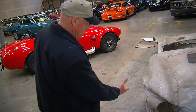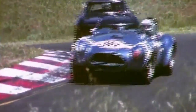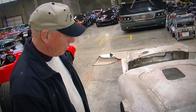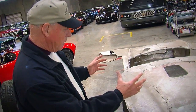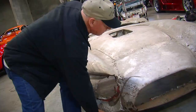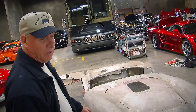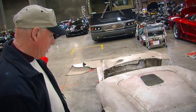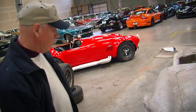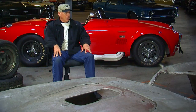The only thing that's missing in terms of the front — of course, you had the headlights, which had to be functional. You taped them up during the race so that if they cracked or broke, they wouldn't shatter all over the place. It was originally kind of a street car, but now you realize just exactly what it is: a straight, functional car. It had the brake ducts hooked up down here, which forced air into the front disc brakes and helped cool them during braking — dropping from 140 down to 10 mph during a 30-minute race. The full-lipped fenders were widened for the wider tires, and the tires were right at the edge. There was a lot of tire on this car.